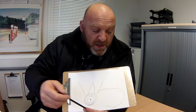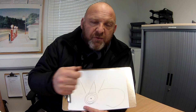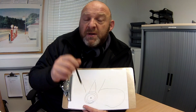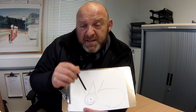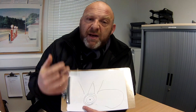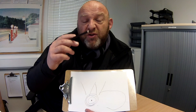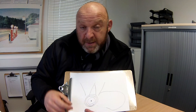How you access it: you have to take off the primary case. You have to drain the lubricant — the oil of course — and take off the primary case. And you will actually locate it at the base of the engine, at the end of the crankshaft. You have two components in the alternator case itself, and that is the rotor and the stator. The stator is the fixed part. The rotor is the rotating magnets that go around, which actually induce an electromagnetic induction, causing the peaks and troughs of the voltage that is created. That is all sent to the voltage regulator and then all sent to the battery.